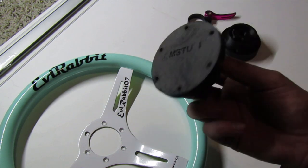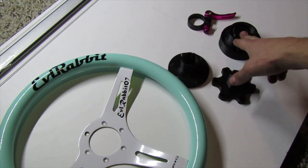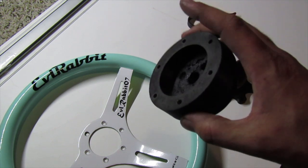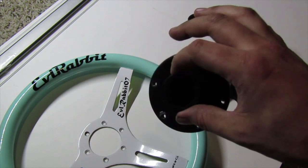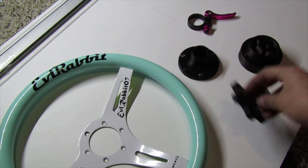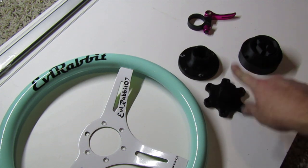This adapter is set to a full solid fill, so it's solid — and it's still pretty light, which I like. All these other pieces are really lightweight at 20% fill and I haven't had a problem with them yet, but I would probably recommend printing them at a higher fill. The way this one is beveled, I'm not too worried about it either, but I'd recommend printing these at a higher fill rate.